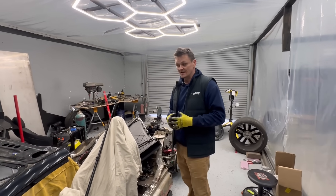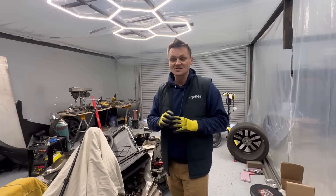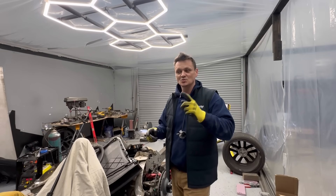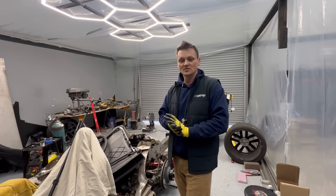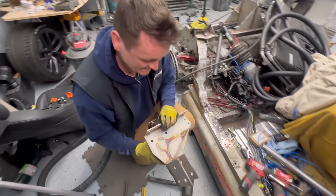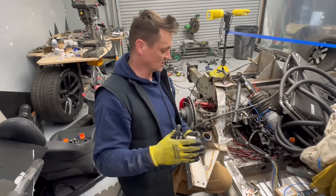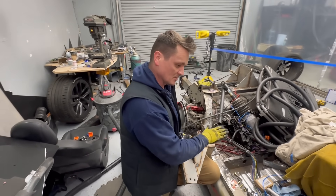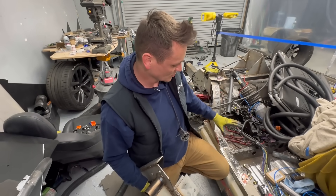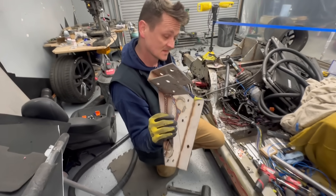Right now I'm at the point where I need to build this skeleton. I'm not gonna be rounding the tubes — this chromoly is extremely strong. I used two different machines to bend this pipe: eight ton, twelve ton — they both broke. I'm still gonna do complete overkill on this. This right here is the B-pillar bracket. Usually you're supposed to put the roll cage on the bottom, basically on the floor, but since the battery is on the other side, and the aluminum is very thin, it's kind of pointless to try to attach it to that.